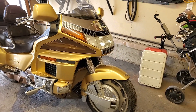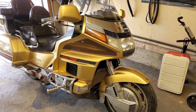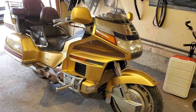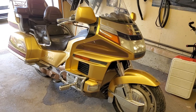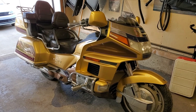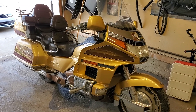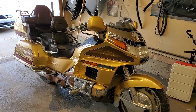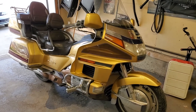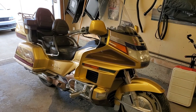And then the front. So the next step will be to drain the gas, refill the gas, drain it again, fill it, reattach it to the carburetor. Hopefully we'll just spray some carb cleaner down, check the oil, make sure it is full. And then I'm going to put a new battery in it and try and start it just to see if it turns over. That way I'll know as I'm working on the bike, if I mess something up and it doesn't run, it'll narrow down what's gone wrong. Then we'll change all the fluids, brake pads, everything. And see if we can maybe get it on the road this year.